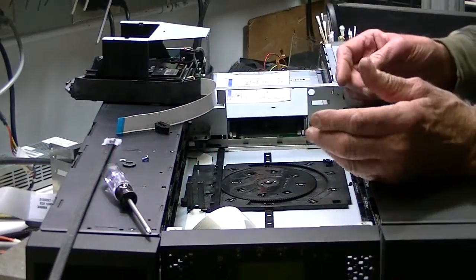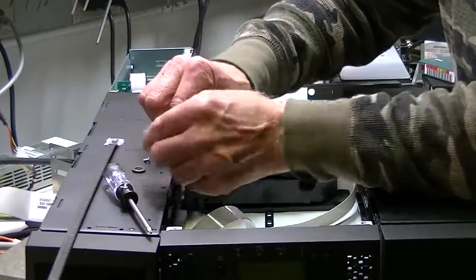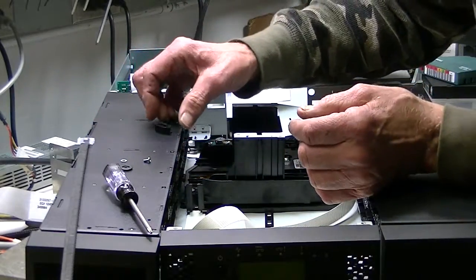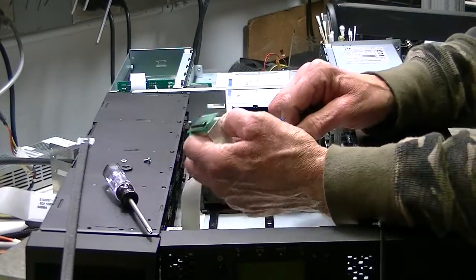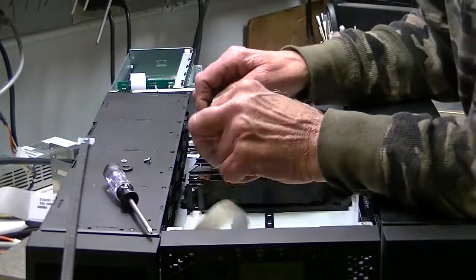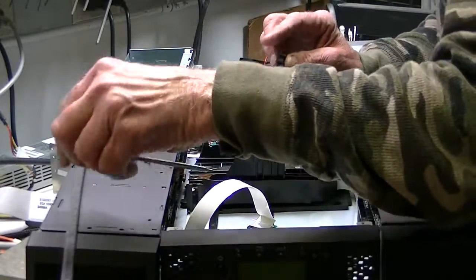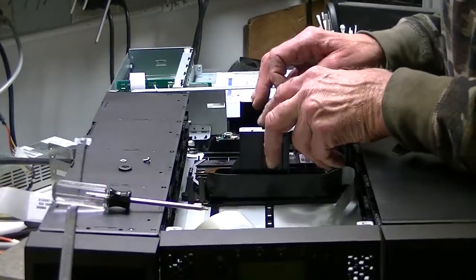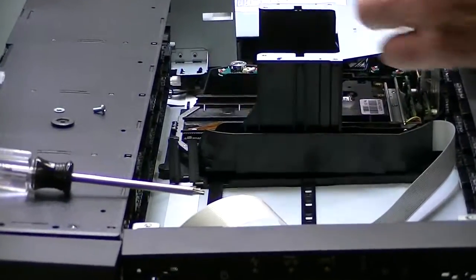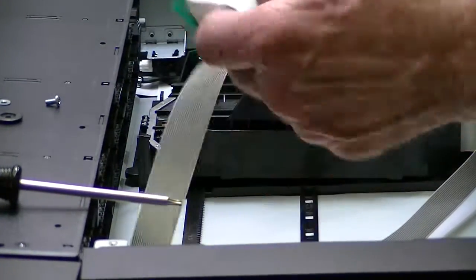We sell these plastic rack pieces as well, and this would be the time to replace one. Reassembly is just going backwards: put the picker on, then the plastic washer, the small washer, the screw, then the circuit board and cable back in place, and the cap on top. Be careful getting the circuit board out, because a lot of people get too aggressive — there's a small clip that holds it and they push too hard and break it. Just take your time and gently push that little tab down and the circuit board should come out without issue.